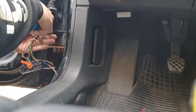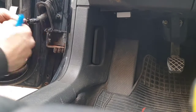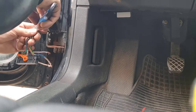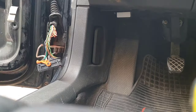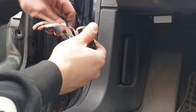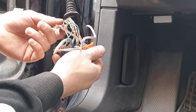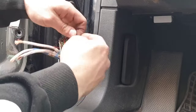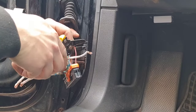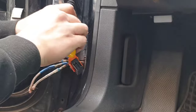To start working, I'll remove about 5 cm of the protective coating to have plenty of space. While doing all this work for those 4 wires, I might as well check and fix other wires that have cracked and broken insulation. I found a few cracked wires, so I'm going to fix them and show you a few different methods to do that.